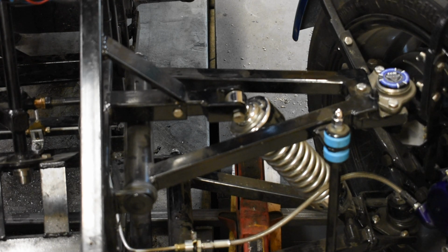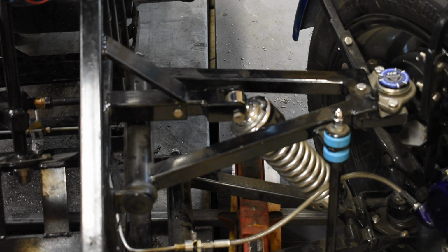The trick here on these valves, like I say, if you have a firm handle like that and the brakes don't drag, that is ideal. That's exactly where it should be. If the brakes drag, where you're getting a lot of brake dust, and when you stop, you can tell the thing just wants to stay put, that's where we have to change the pressure setting on that valve. Other than that, these brakes require really no maintenance. You can bleed them out like you normally would every couple of years or whatever. But that's really all there is to it. And the main precaution here is just make sure you don't spill brake fluid everywhere.